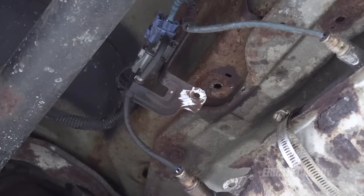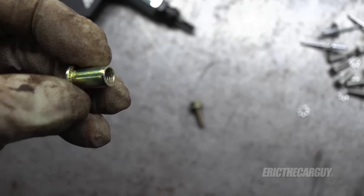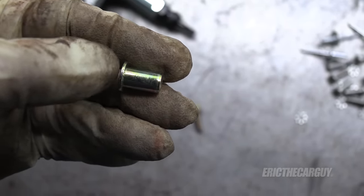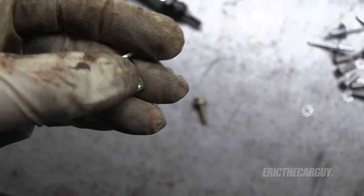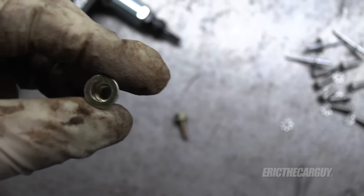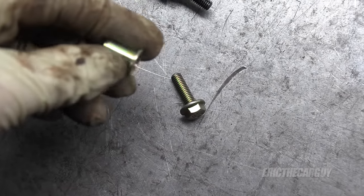We have the hole and I have some nutserts, so I'm going to put a nutsert up in there and redo those threads. For those not familiar with what a nutsert is — this is one here. It goes into a regular hole, and with thin sheet metal like what we have here, it's the perfect thing. It works with a rivet gun; when you compress the rivet gun, it pulls this in and sandwiches it between the metal, holding it in place with a new set of threads. This is an M6, which is pretty much the same bolt that was in there. Thankfully, they provided an additional fastener in the kit, so that will screw right in when we're done.